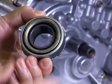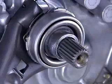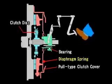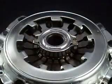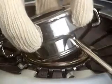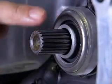The release bearing must always be replaced with a new one. Confirm there is no grease leakage or damage and that the bearing turns smoothly. Some clutch covers are pull type and you can disengage the clutch by pulling the diaphragm spring. Exedy pull type clutch covers employ a snap-in mechanism for extremely easy removal and bearing replacement. Finally, confirm there is no end float in the top shaft and check the teeth for wear.